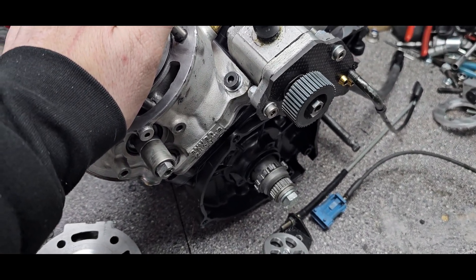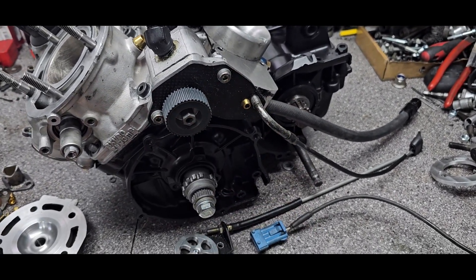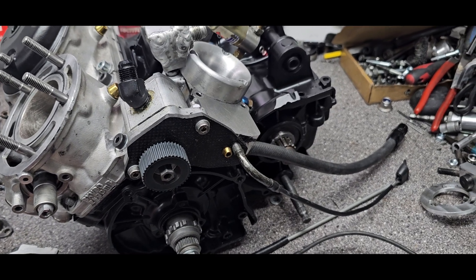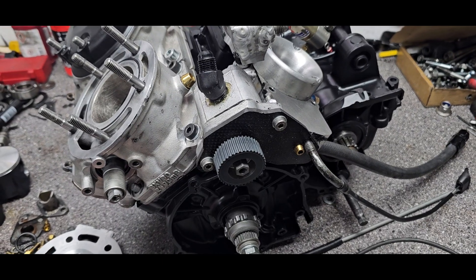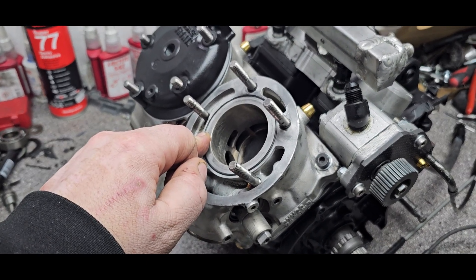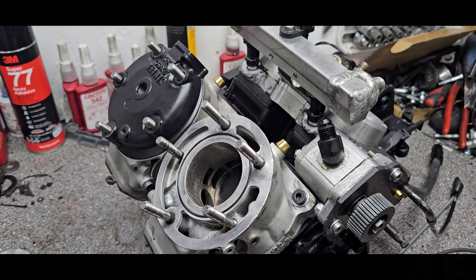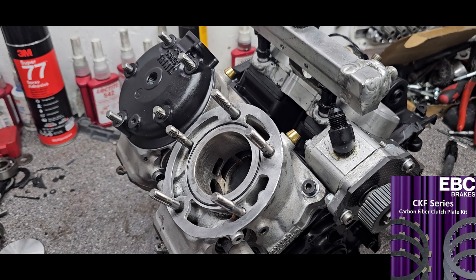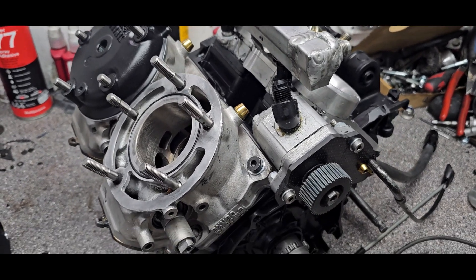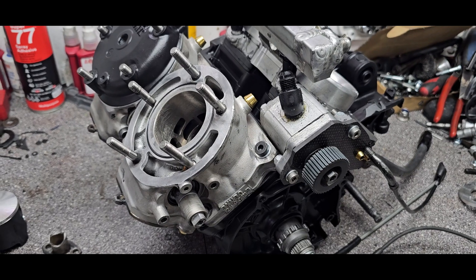This is the TDR 250 engine from the beginning, but I got the TZR gearbox with a longer first gear, and I'll also slide down the changes on the gearing. I'm running clutch discs from a four-stroke Yamaha YZF 250 — carbon discs — and I modded it so I got eight springs, and it's very easy to slip the clutch and make it very easy to control.